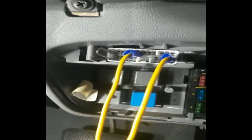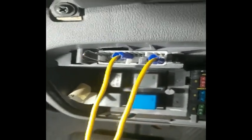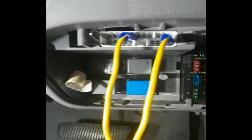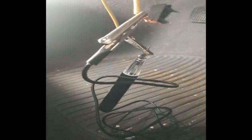So this is what it looks like when it's all hooked up. You can see the paper clip there, that's bridging the first two ports. Then from the top, the fifth pin from the left is connected up to a simple wiring connector, and the bottom right pin is also hooked up — I've just got that going down to a test light. One wire is hooked up to a paper clip, and that there is simulating the wire on the right-hand side, that's the positive. That's going to the end of my test light, and I've got an alligator clip going to the point of the other side of the test light.